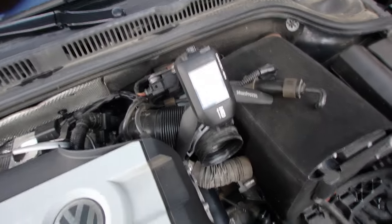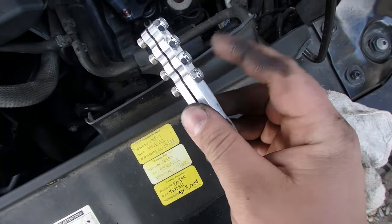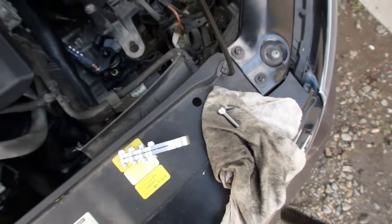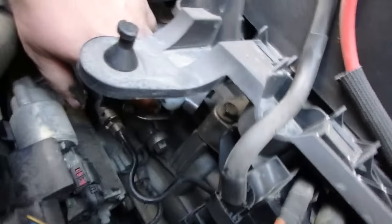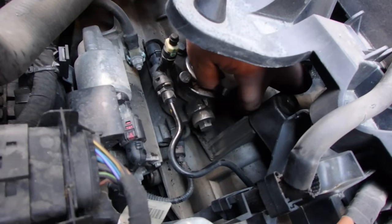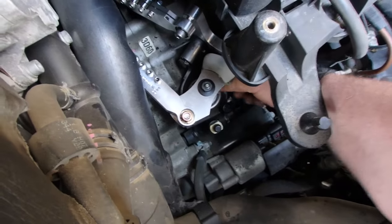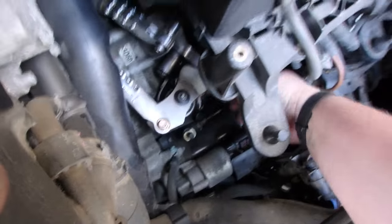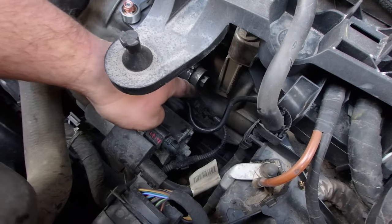Stick this piece in — when this goes in, this has to be facing up. So you're going to insert this in the cable end first. It's got blue loctite in those threads already, then we're going to tighten it up. Underneath here I put a 13 mil socket and that prevents the shifter from coming back when I tighten it. Make sure it's good and snug. I'm going to lift this up and pull that socket out. Set the shifter and you can see right there there's that little L-shaped bracket.